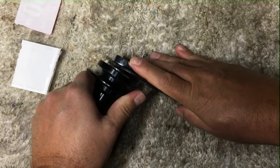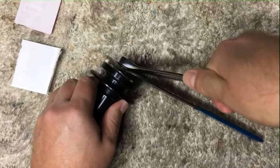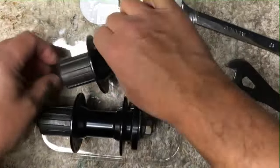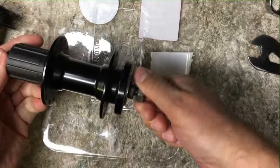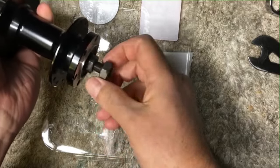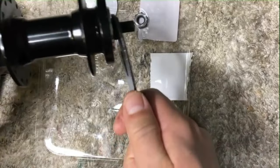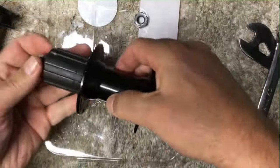There is a trick where you tighten a nut and then loosen it because you're trying to get movement on the nut, but in this particular case I was able to do it without, although I did have that one little snappy setback. You just loosen off the lock nut — it's been a while since this one's been off, but it came off all right. Now sometimes the cone is going to be stuck nice and tight in there, so you loosen off with the cone wrench and use the lock nut on the drive side to hold it in place.